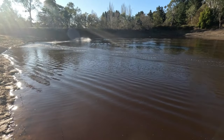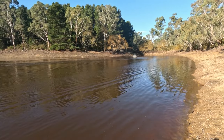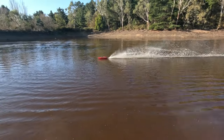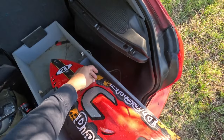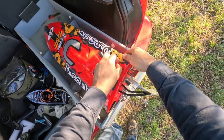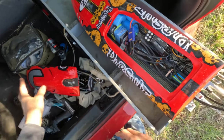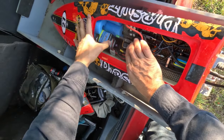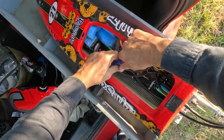I'm running 6s and this motor can handle 8s. I gotta get some big trim tabs on this thing, but I actually forgot to put the turn fin on it too, which probably didn't help. Still turns okay though. I had another option — sliding this battery forward; it's on a plate so I could have done that. I'll get the trim tabs on then come out when I'm a bit more serious about it.